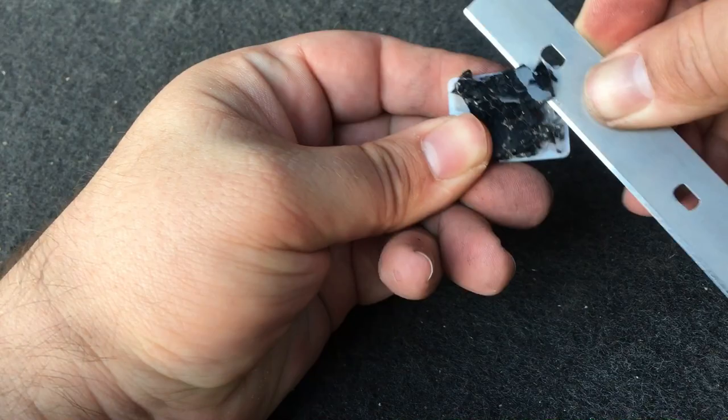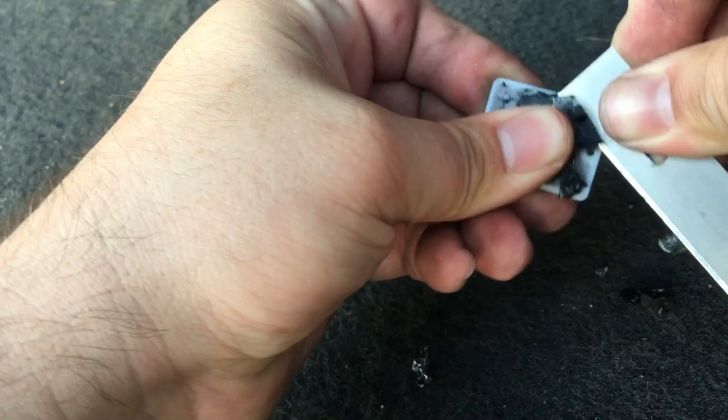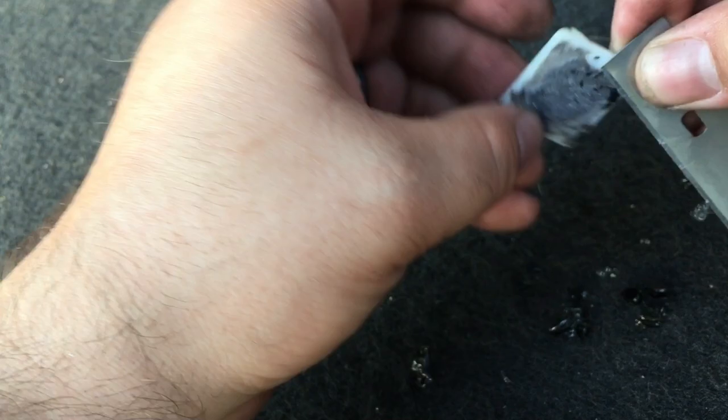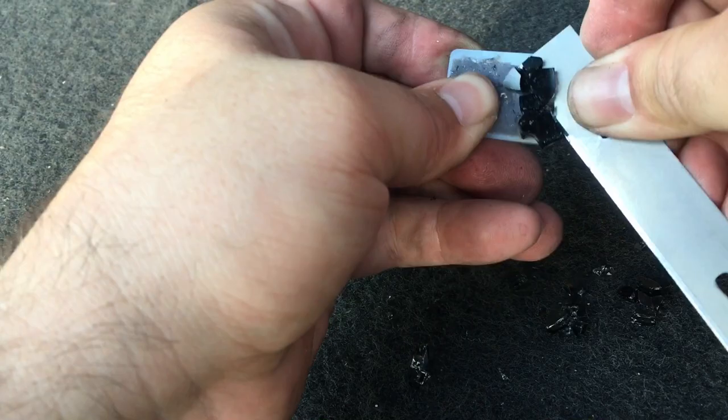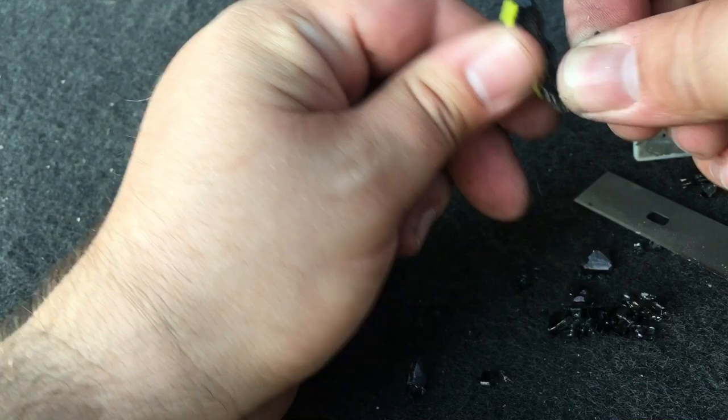So here I have those three pieces that were on the old window. They align the glass. There are these markers on the glass, these little arrows that help me align it, and they snap in. But the adhesive that's on them is basically a thicker 3M tape. So what I'm going to be doing is replacing that adhesive and sticking these to the new window, so that we can align it properly and adhere it. If you listen closely when I go to adhere the glass, you'll hear these three snaps.